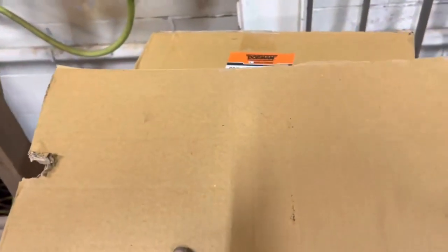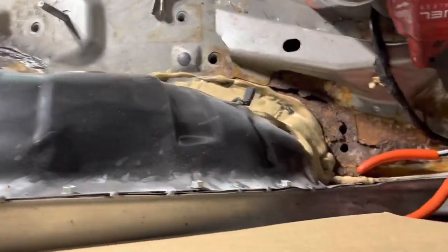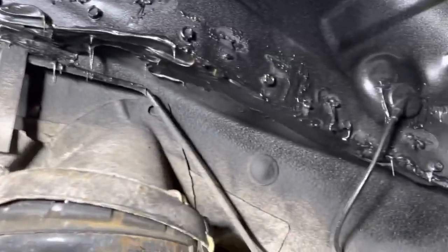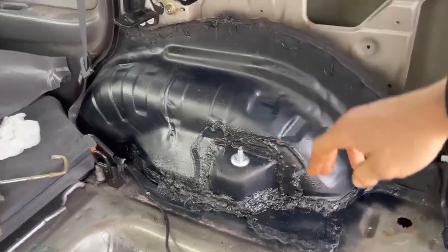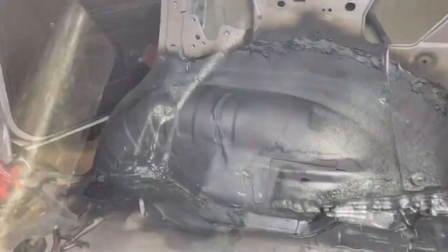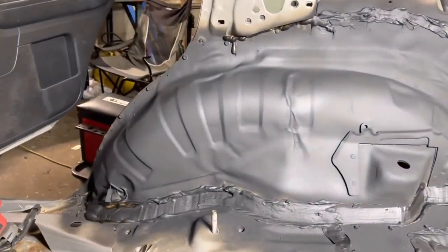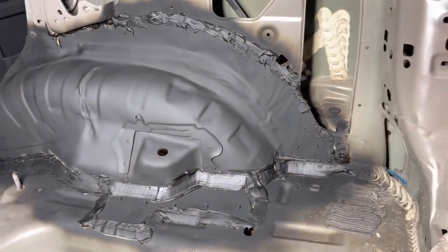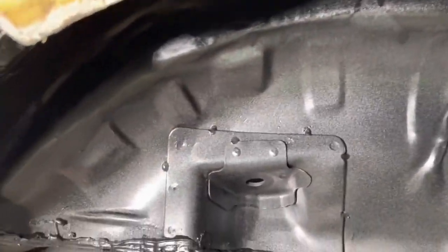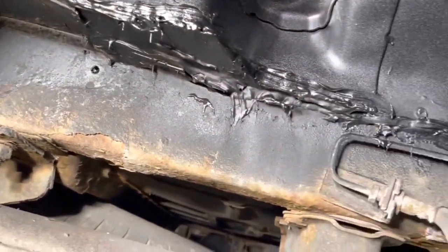I take a flap cut off my shock tower and use it as a guard right here so I can spray down along here and keep it from getting everywhere. When you do this, make sure you get up underneath your lip to seal that up as well. Epoxy the outside and up around the top and areas to seal it — also epoxy above this rim right here. This is what it looks like when you're all done — turns out looking excellent, sealed up and ready for many more years on the road. The outside portion looks excellent as well — there's rust on the body but no longer on the shock tower, so it's safe to drive anywhere.